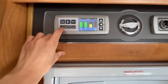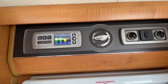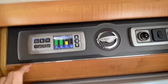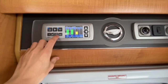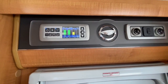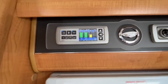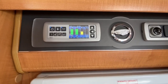Below here you've got the awning light switch — this is the light outside the vehicle. If you are sitting outside on a nice night and it gets a little dark, you can put the awning light on. This is a dimmer switch which dims the lights. And this one here is the power transfer, which transfers the motorhome to using the engine battery if the leisure battery was to go flat. We don't advise using this because if you drain your engine battery, you'll not be able to start the vehicle and you'll have to get a jump start.